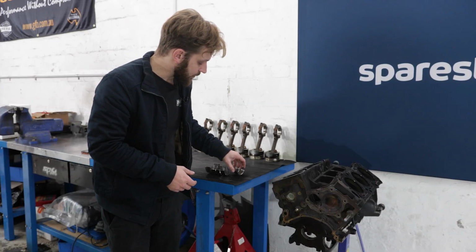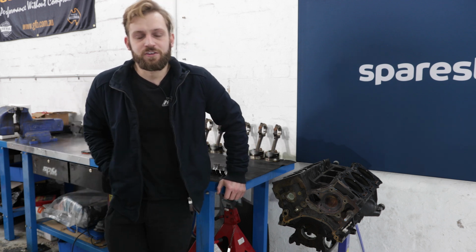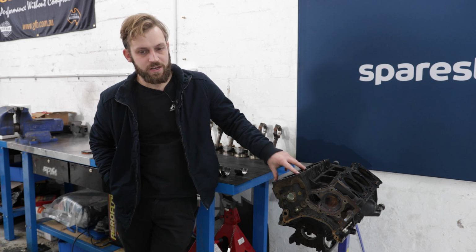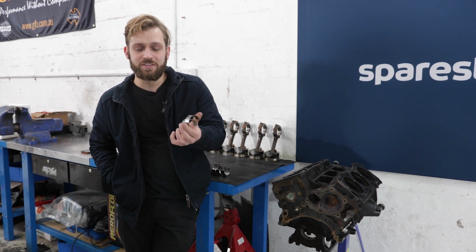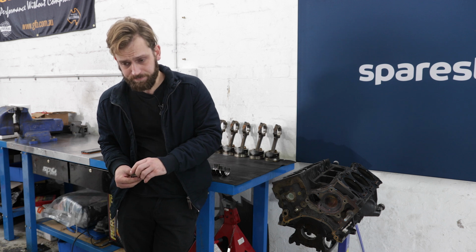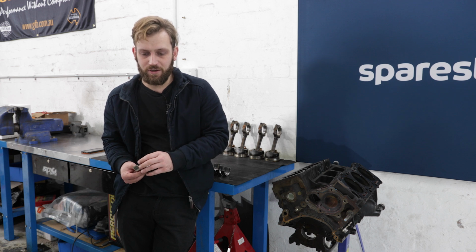And he turned the car off and saved us from any sort of real damage. The struggle with diagnosing an issue with an engine is quite often you'll have something like that, which is a symptom, and you have to find a cause, not other symptoms. So a good example of this might be a spun bearing here, and you might find heavy scoring on the bores. And it would be very easy to say to yourself, okay, well, this is a failure due to debris.